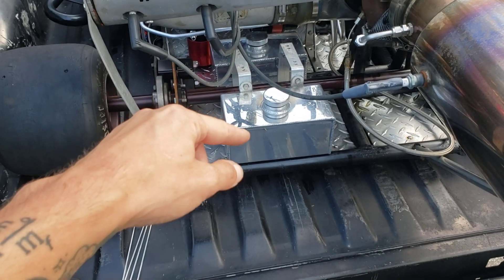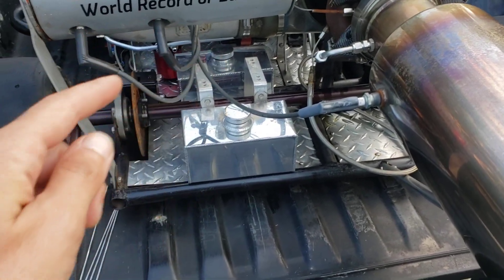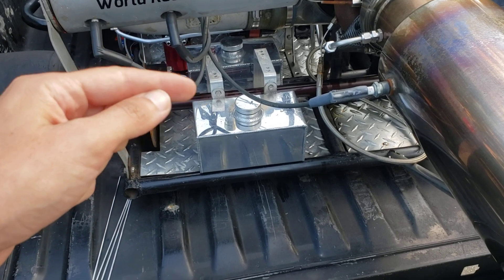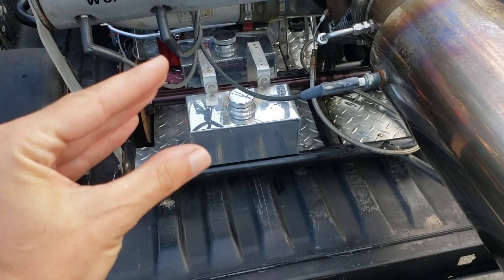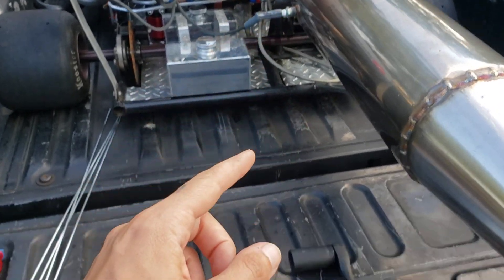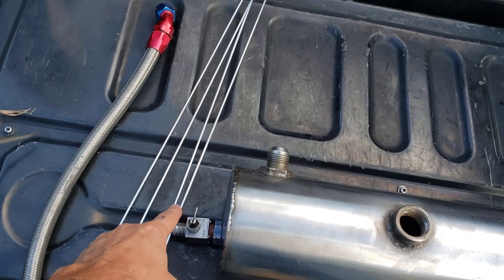So I'm going to take out those two little oil tanks. I got those thinking I might use them, but it's going to require a little extra plumbing — both tanks have to kind of drain into each other and then get siphoned out by the pump. We're not going to do that. We're just going to do like the original tank, just from the turbo to the return.